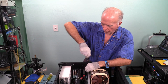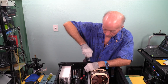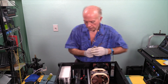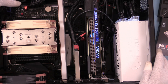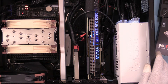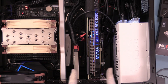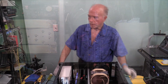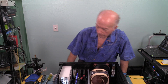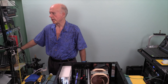As soon as we get a post — the only thing different was putting the Seagate FireCuda drive back on the motherboard — we're going to try to put the Supermicro card back in. We power up, watching the BIOS code hoping we don't get 94 again. I made only one change in the BIOS: turning on above 4G decoding. We got a post. All I did was turn on above 4G decoding, so that has to be turned on now.